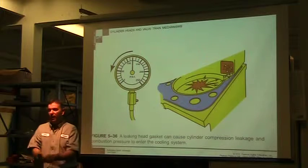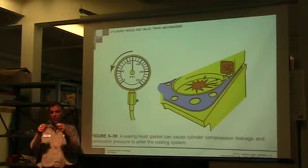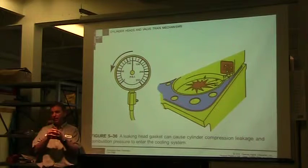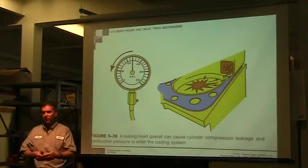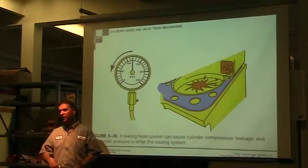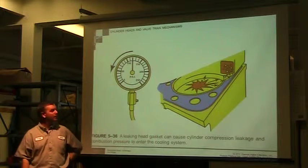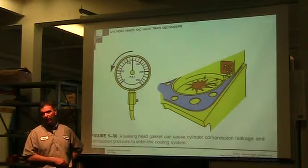So the most common problem with that tractor was the intercooler. We pulled it off, we pressurized it, there were no leaks. The next most common was the expensive problem we had. We ended up with the engine apart, all new liners, all new pistons, new rings, new gaskets, all that kind of stuff. It was expensive, all because they ran straight water and it pitted the liner.